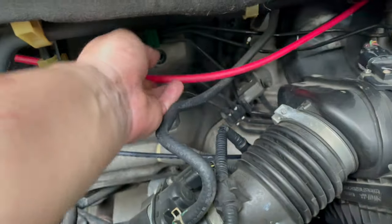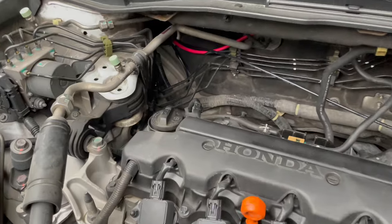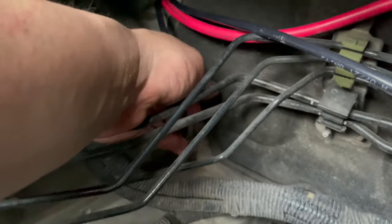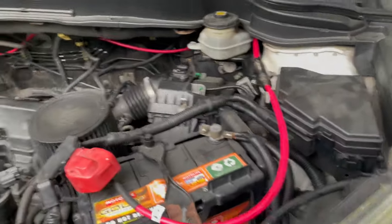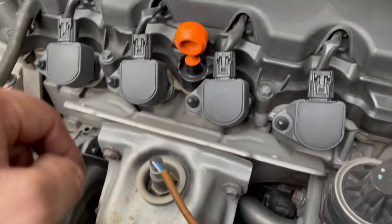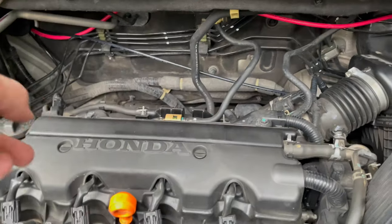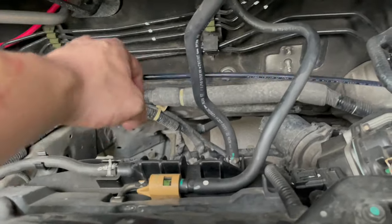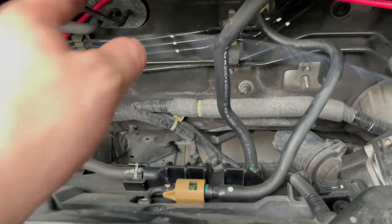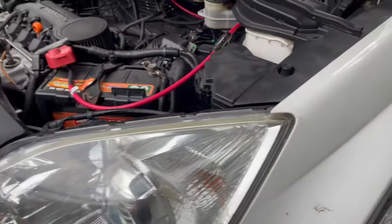Tie this up so it's nicely tucked along with the airline hose — we're still installing the air struts. Make sure not to cause any kinks and give it some slack, otherwise you're going to have problems. One thing to note: if you're running a boosted car like an Evo, the turbo is in the back. If running airline hoses, try to run them to the left side and right side separately — don't make the common mistake of running airline hoses close to the turbo, because they will melt. Even braided hoses will be an issue.